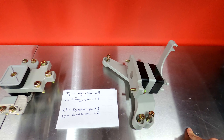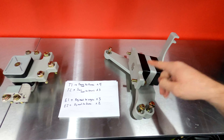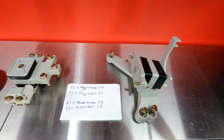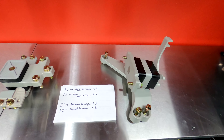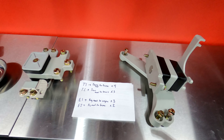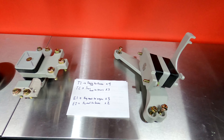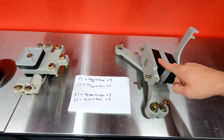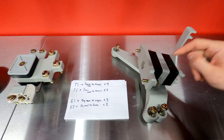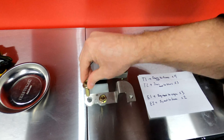Here's what you're going to get when you order the BFI or Black Forest Industries stage one engine mount. Stage one has the black poly — it's really for your daily driver. If you're not planning on going to the track or you don't want excessive NVH, these are the ones you're going to want. They will stiffen up the drivetrain a little bit, help you put a little more power to the ground, and won't rattle your teeth out.